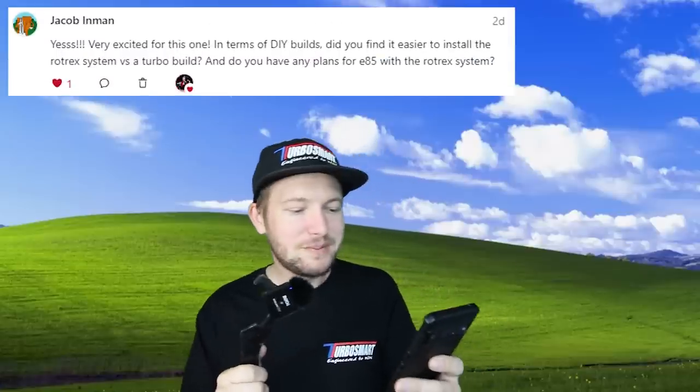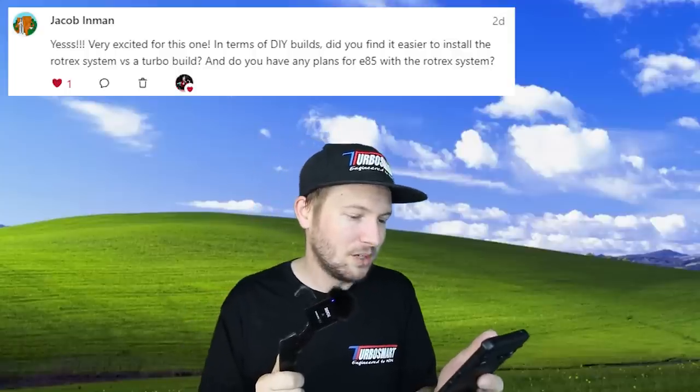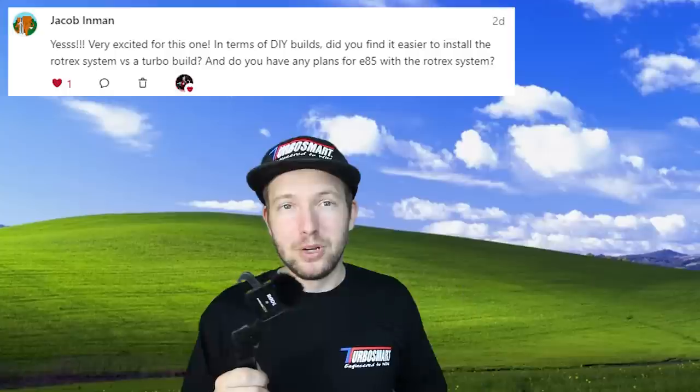Jacob says, in terms of DIY builds, did you find it easier to install the Rotrex system versus a turbo build? And do you have any plans of going E85? Briefly touched on this earlier, I think it is a little bit easier to install the Rotrex system as a whole. You just have less systems on the engine to mess with, mostly the exhaust system. You don't have to touch it, and then you don't have to worry about oil feed and drain.